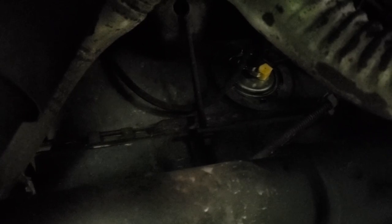As you can see on this fuel tank, that nice shiny bit right there is the fuel pump they already installed — but like you heard, it was humming. I'm pretty positive by the looks of the nuts on these hangers, there's no rust removed from those bolts. So I'm pretty positive they didn't drop the tank — they just put a new pump in — and I'm pretty sure there are obstructions in the tank. So we're going to drop the tank down and clean it out.